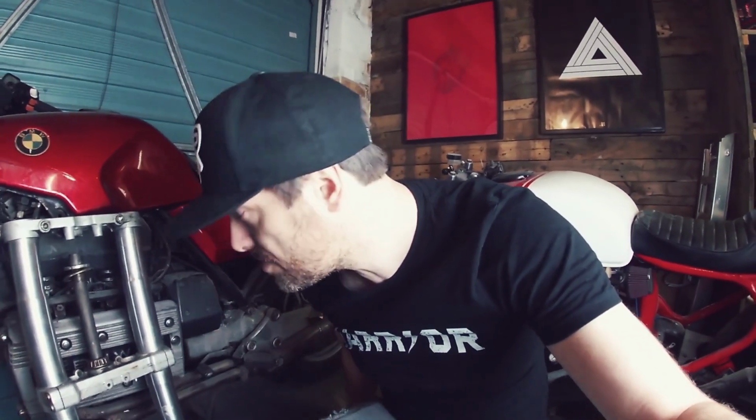Yes, there are problems that come from doing that, and that's your caliper position, brake disc. Well, the caliper stays the same because that's connected to the fork itself, but the brake disc to the caliper might have to CNC some spacers and things, but again, that's not the end of the world to do that. It's nothing massive. In fact, let's check how far apart these are.